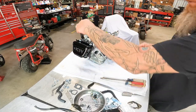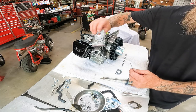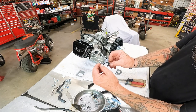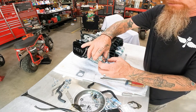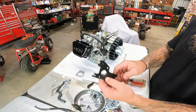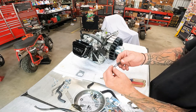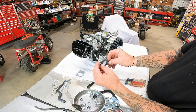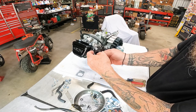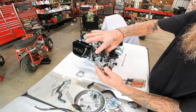Let's get this turned around. Let's go ahead and find the gaskets — they sent new gaskets with the kit but the old ones came off good, so we're going to save the new ones in a bag for if I'm working on something else. These all came off really nicely, so we're going to repurpose the ones that came off the engine. Slide your back gasket on, make sure everything lines up good. Then pull the insulator piece that came off back on, and your back gasket. Little carburetor goes right there — just like so.